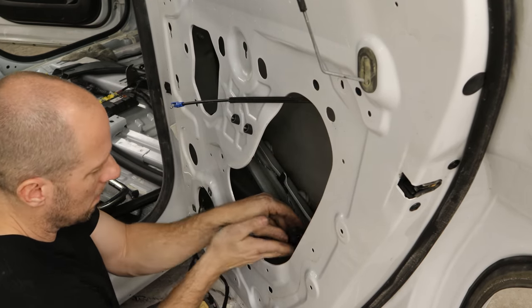Slide our belt molding in the back and clip it down with our belt molding installation tool. Put the window sweep in and we'll put the plastic around the top of the window. Clip it into that molding — actually in the back it clips into the window, and then it clips into the molding on the top and in the front. Put our little pushpin in the bottom of it and we're ready to put our water barrier back up.